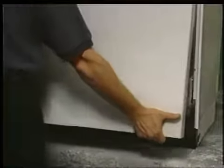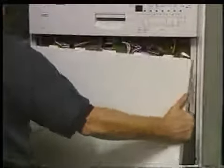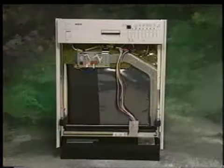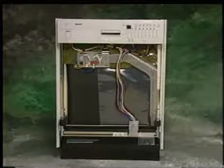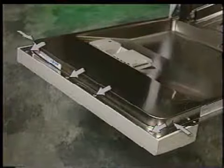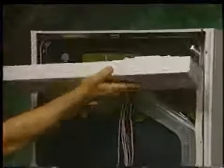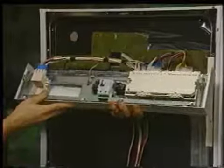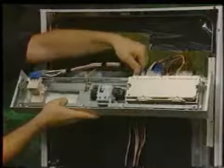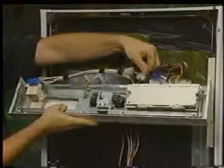The control panel can be removed from the dishwasher as a complete assembly, but in order to do so, the outer door must first be removed. You cannot remove the control panel without first removing the outer door. Now with the outer door removed, remove the six remaining control panel screws from the inner door. With the screws removed, bring the control panel assembly down, turning it over to reveal the component wiring. Make sure to cradle the console so as not to scratch it. Now remove each wiring connector by pressing in on the connector tab and then sliding each connector off the board.